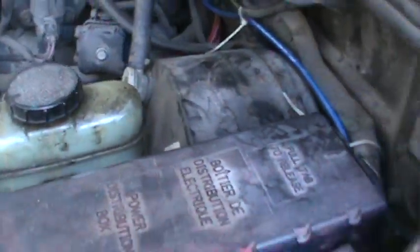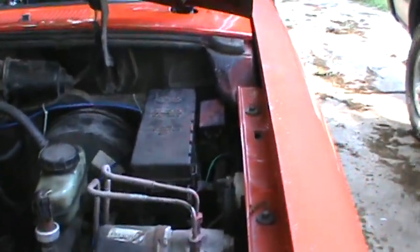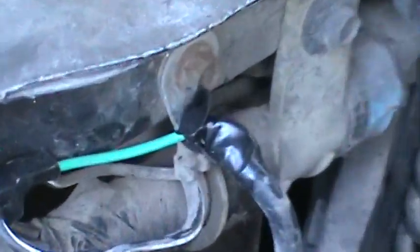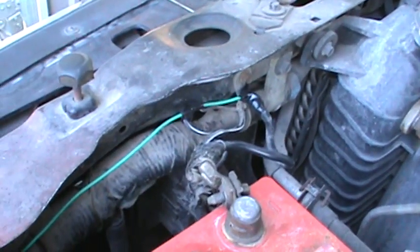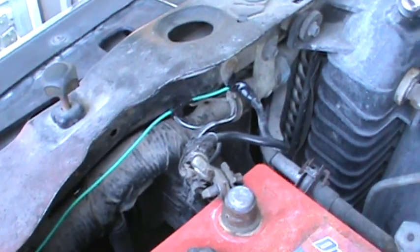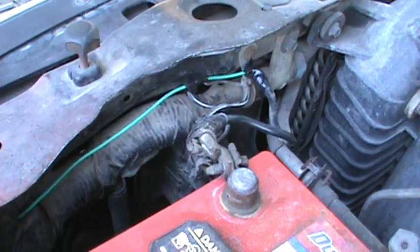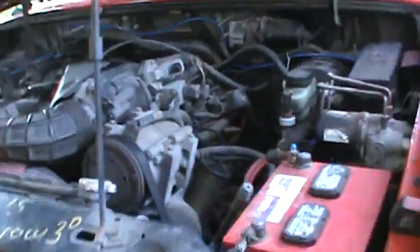But for anybody else that has a Ford, that little piece of wire, like I said, I've got it run up here and tied into the other ground there. I could have made it shorter and just looped it from where ground's inside, but it's always good to have a little bit of extra wire that you can cannibalize on a vehicle in case you get broken down somewhere and need a piece of wire. But anyway, wanted to share that with you guys.